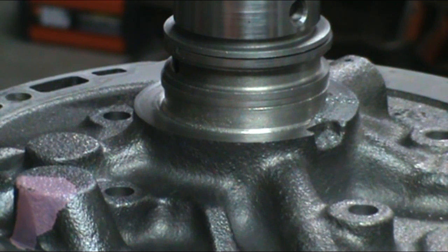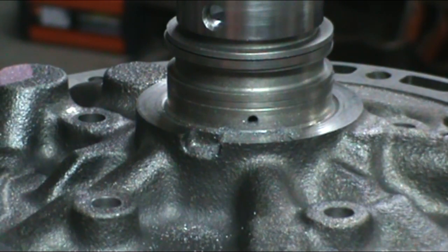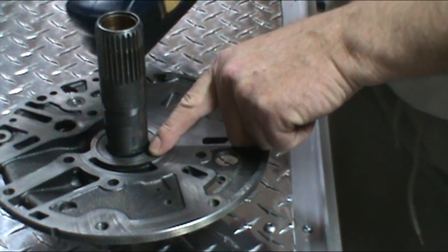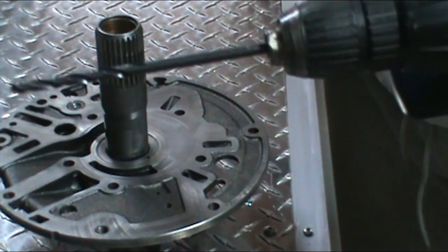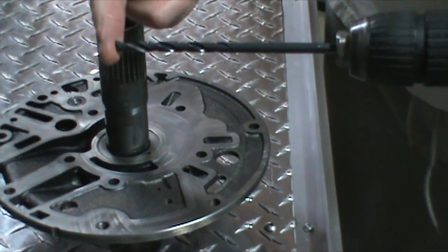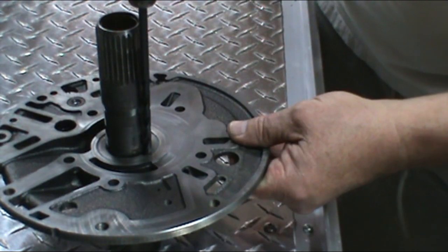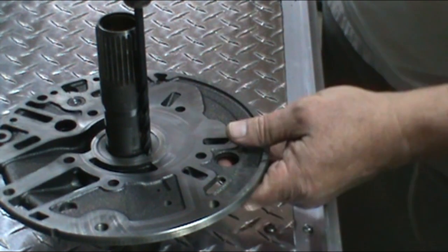You'll feel when you get through. We've gone ahead and opened that up to 110 thou. Now we're going to drill this hole out to a quarter of an inch. A normal drill bit won't work — the reason being the stator is so tall, you're going to have to get an extra-long drill bit, just a quarter of an inch. I went and purchased one that's over 6 inches long so that we can go down and drill that hole. Now this is a converter fill hole, so that's going to allow the fluid to get back to the converter faster.